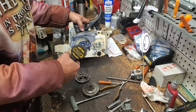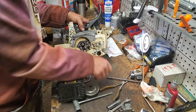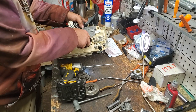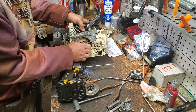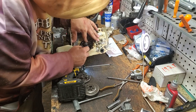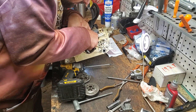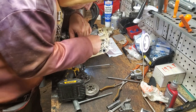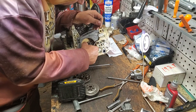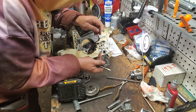Okay, and then your oil pump has an elbow on it right here that pivots, and so just pop that out. Pull that elbow back right here, and then you can release it from your line down here. We have permatexed it as insurance, and so it'll take us a little bit extra to get it off because it's sealed on there real nice, but we will get it. Okay, you can go ahead and pull that worm gear. It just kind of angles out.